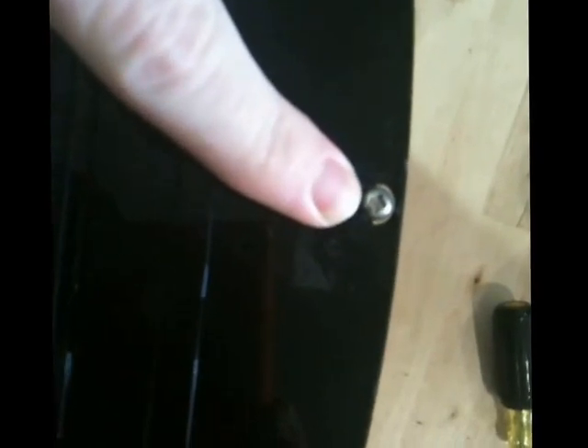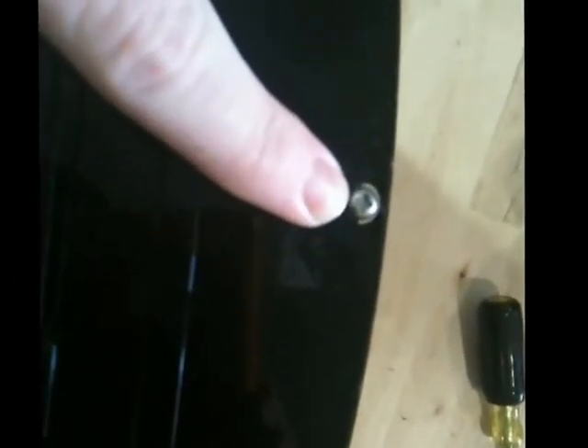The first thing you're going to do is remove this top cover. This just sort of slides over to the left like that and lifts up. Over here on the left side there are two pieces that are important. There's a screw here that's usually covered by a little rubber foot, and there's also this little cover that holds the hard drive. Take your fingernail or flat head screwdriver, just pop that side off and this just lifts up — and there's the hard drive.